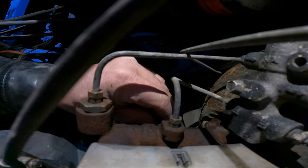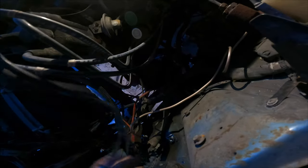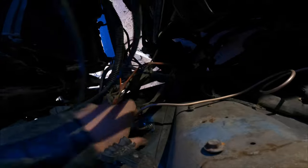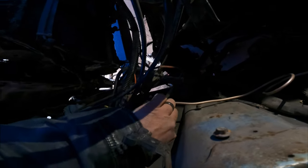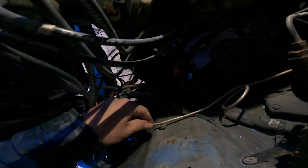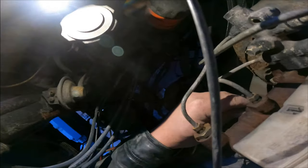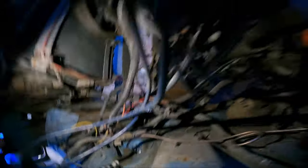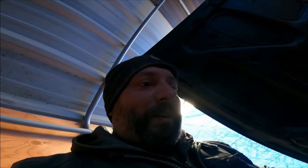At the bottom of the brake booster there is a fitting — that's where this end is going. I had already installed the new brake line fitting over here, and that there is going to go right down in there. Maneuver the brake line a little bit to get out of the way of things — and that one's installed. I just gotta go get the wrench to tighten everything down. That is the first brake line. The second one is on the passenger side — it's quite a bit longer so there'll be a little more to it.